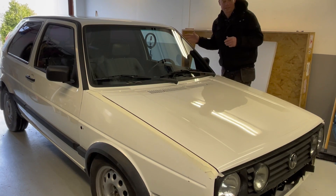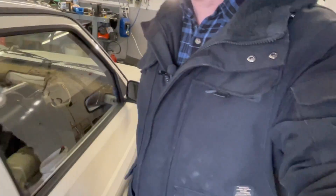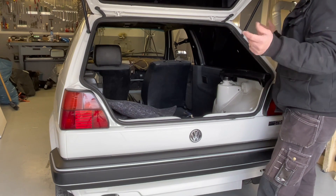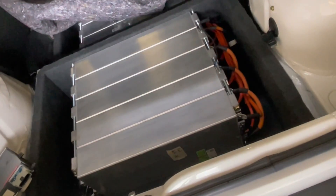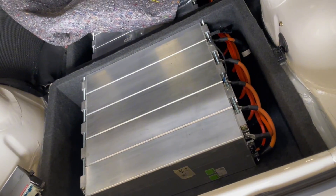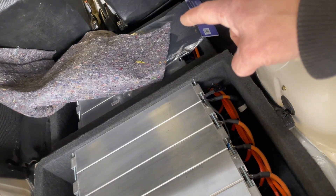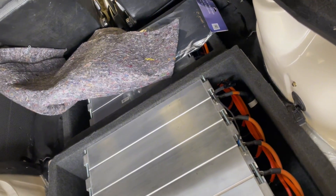And of course, the battery — let's take a quick look at that before we wrap up for today. In the last video I produced the bus bars — well, it's a cable, but you know what I mean. Here it is. You can see the main fuse right there. I have it between the fourth and fifth battery. I have some plastic pieces laying around so I don't accidentally put my hands down there, because there is the main positive and the main negative right there. Everything is bolted so nothing can come loose.